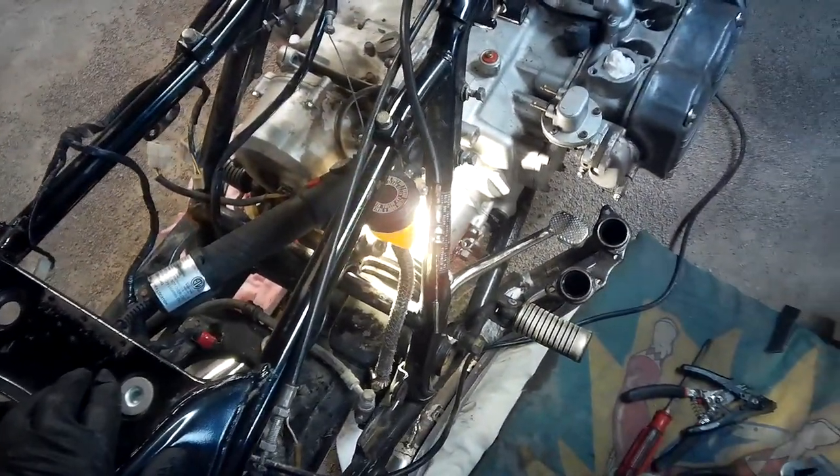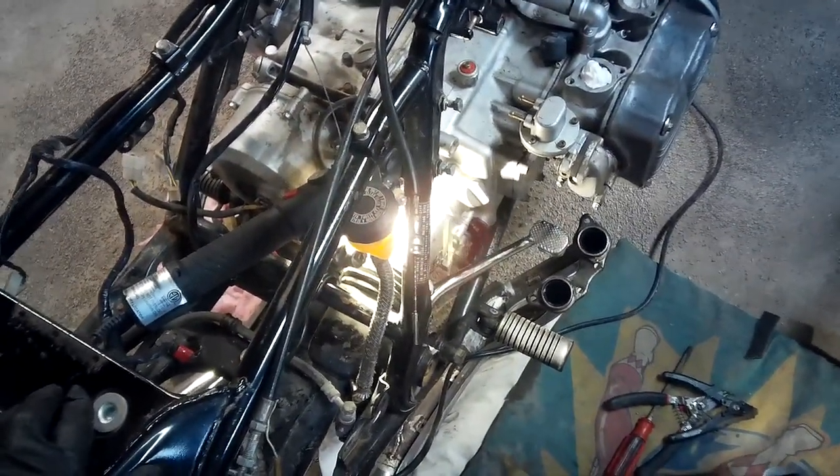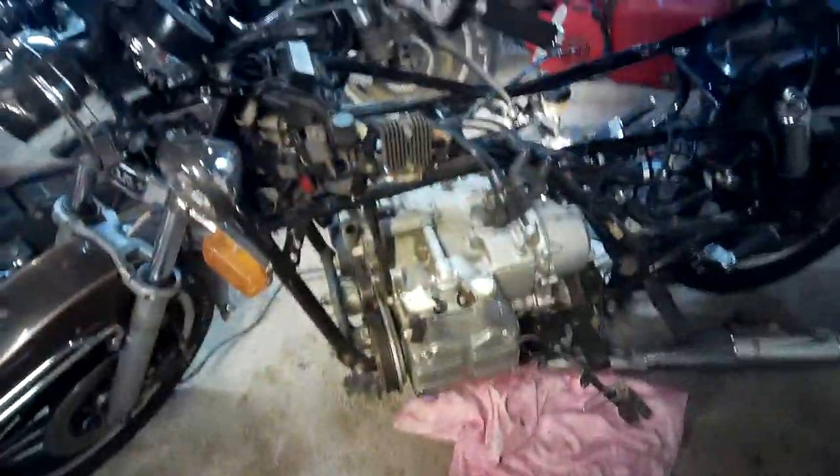You just have to find some way to hold this boot back. I don't know what Honda was thinking there - it's not as if this driveshaft is going to slide out, so I don't even know why that circlip is there. Maybe it was a governmental requirement or something. But anyway, it's almost ready to be pulled too - basically it's being held on by about eight bolts but they're all loose, so we could pull this at any point.